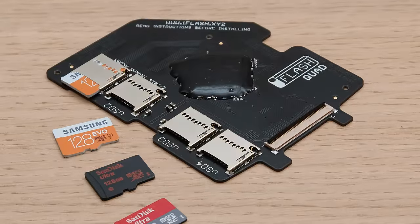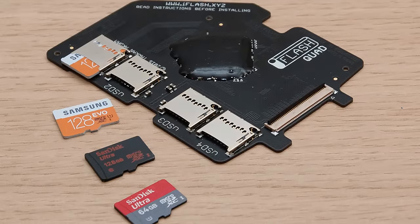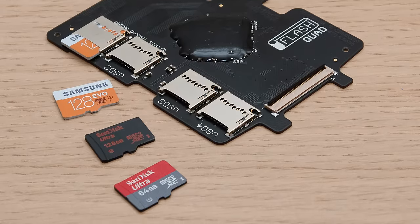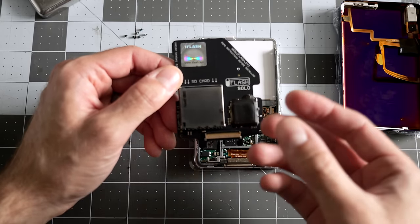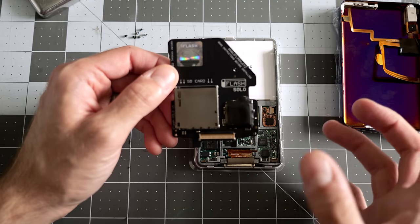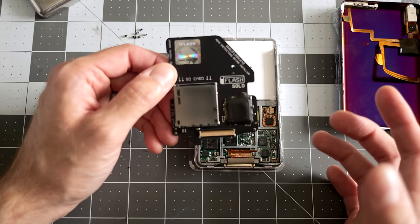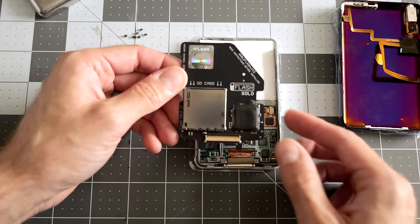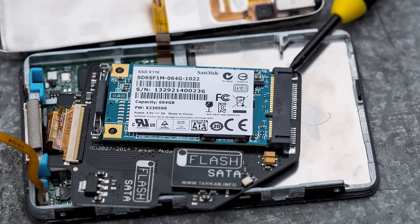Plus, they've got higher end versions of these adapters that can let you either do multiple cards, in which case the adapter will kind of treat them like a RAID array. Like, it'll take all the cards' capacities, put them together, and present that as a single disc to the iPod. So you can do some just stupid large capacities. I think Dankpods did a 2 terabyte iPod once using one of those adapters that supports multiple SD cards. I've also seen some that'll take mSATA SSDs.